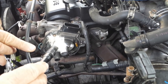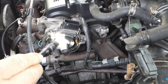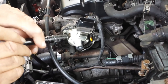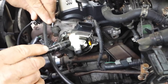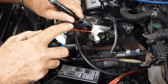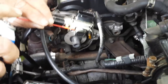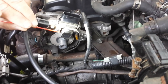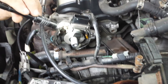You'll be able to see if that's the case because it gets gunky around the edges here. If you had dirt on here, it gets behind this part and gets stuck in there — like something stuck inside a CD player all gunked up. You can take the carb cleaner and, going along the little crack on the side where the little dial goes through, just shoot it out. We did this a while back and blew out a bunch of gunk in there.